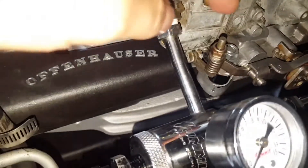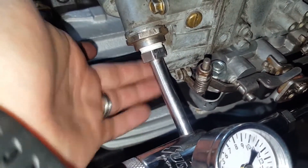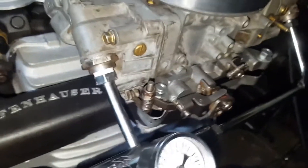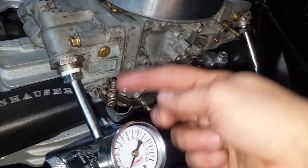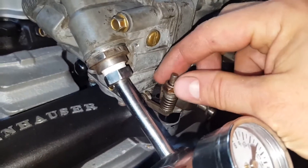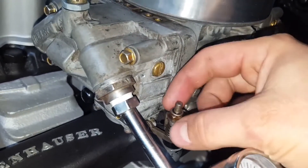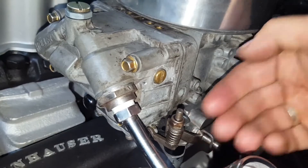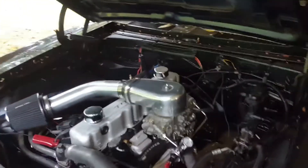The last adjustment before starting the car is the accelerator pump. These little levers, when you pull the throttle, press down onto a lever which presses up on the diaphragm at the bottom of the fuel bowl to squirt fuel. What usually happens to me when I put it back together — especially on the primary side where I can't see it — is I forget about the lever and it just flops upward, leaving the pump dangling and doing nothing. What you want is basically zero clearance — the lever and the pump arm should be touching, so when the throttle comes down it immediately engages the pump with no delay.